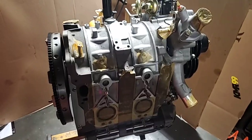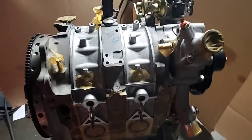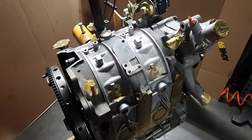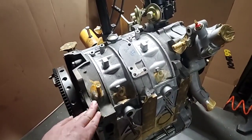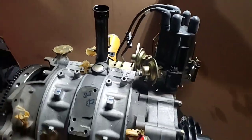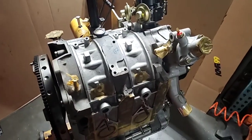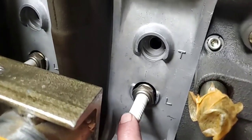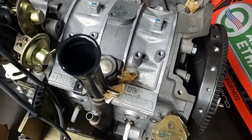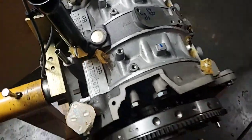It also has a GSL-SE pan for the oil pan. So if you ever come across a brand new 13B from the factory that has Series 5 naturally aspirated rotors with turbo Series 5 end plates and centers, but no injector holes, ceramic seals, a distributor, an early oil pan, and front cover — and almost forgot — it is a single spark plug motor, not drilled or tapped — well, you have an OEM propane motor. That might mean you're either lucky or unlucky.